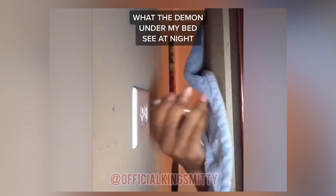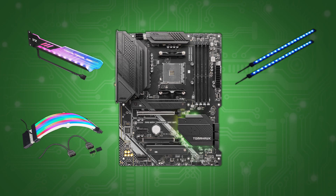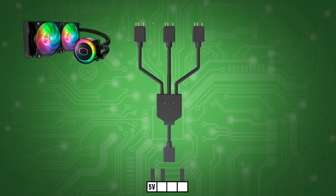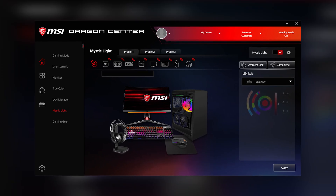The next big question is: where do you plug these specific connectors into? If your motherboard is going to be the only thing controlling your RGB, it's pretty simple. Something like a 3-pin or a 4-pin plugs into the headers on the motherboard and can be divided amongst many devices using an RGB splitter. Everything plugged into these headers can be controlled by the motherboard software.